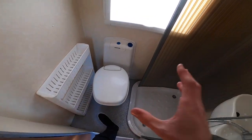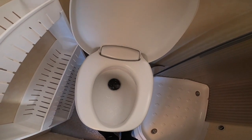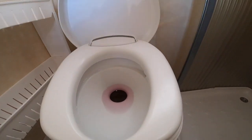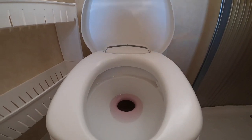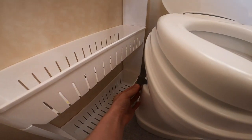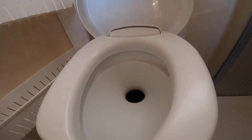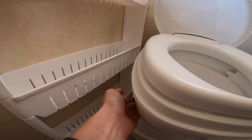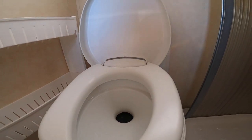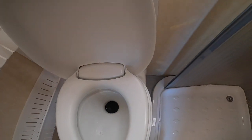Now in the washroom — to operate your toilet, you've got your flush, which is this big blue button here. Make sure the pump's on and you'll get your flush from the header tank — you can see it's a pink diluted liquid. Flush the toilet first before use. Then this is the blade — it has to be shut to get the cassette out. Slide to the right which opens it, everything will go into the cassette. Use the toilet, flush after use and then slide back to the left which seals the blade. Should it be full, you can get it out from the outside. If you get into a habit of doing that, you'll always have it shut when you're ready to empty it.